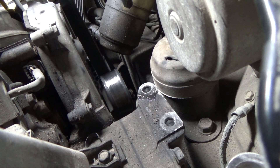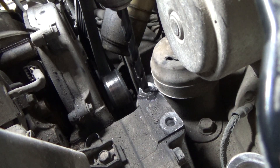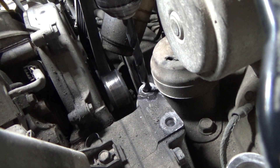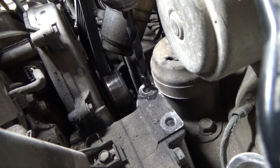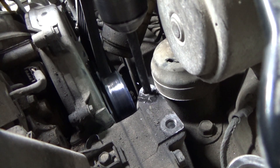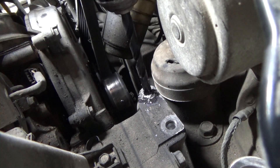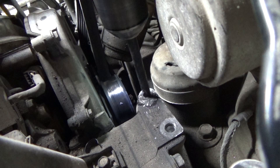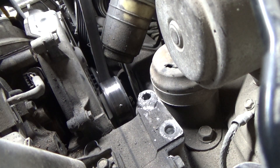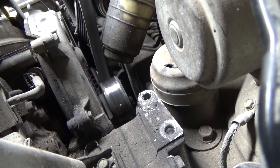I need to make sure this drill is straight up and down, going right into that hole, straight down the centerline of that bolt hole. I hit the bottom — that's as deep as I need to go. Then we'll take a rag and blow this out.